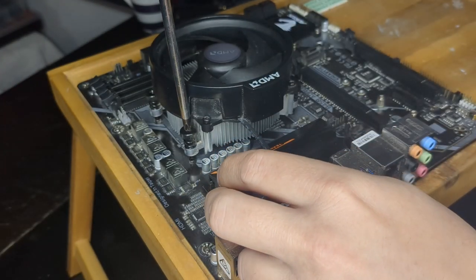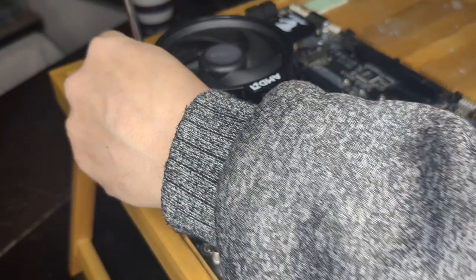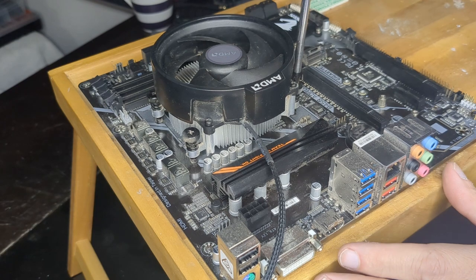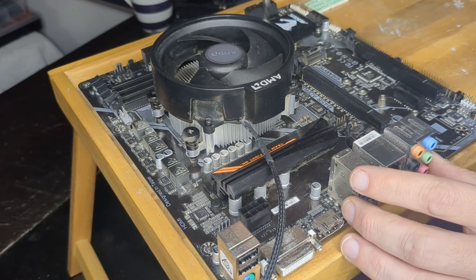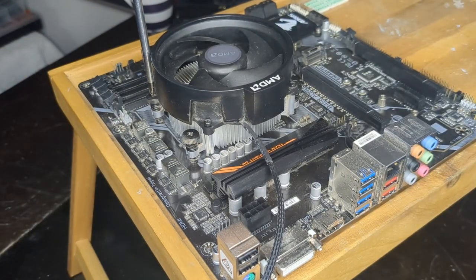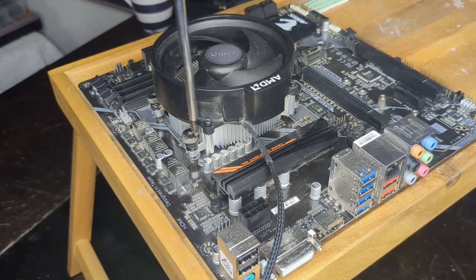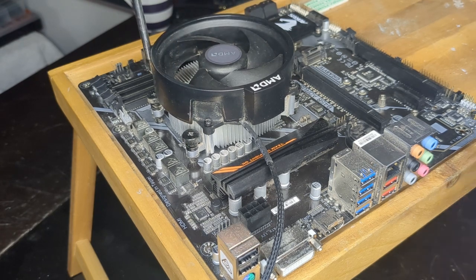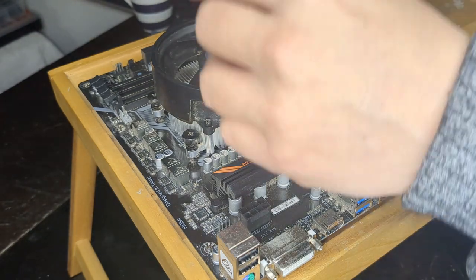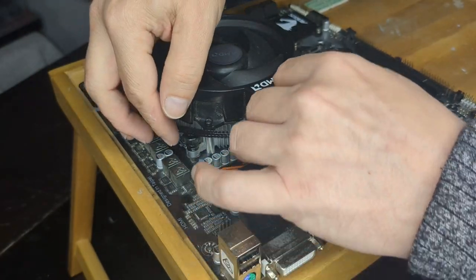The best practice for attaching these back down is don't screw them all the way in and do a cross pattern. You do this one and then that one diagonally because you want even pressure across the CPU. You don't want to screw one side all the way down and then go to the next one — you want to do this cross pattern so you get even pressure on the CPU down there. If there's uneven pressure on the CPU, you can get some weird behavior — memory issues, CPU issues, just weird behavior in general. You don't need to put too much force in these, they have stoppers on them, so you'll know when they're screwed down enough.